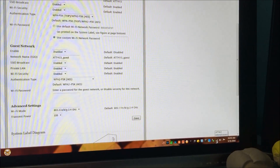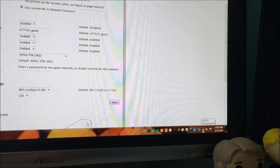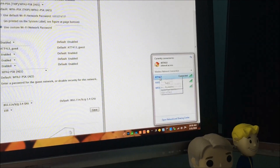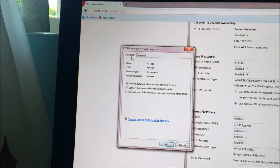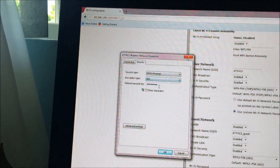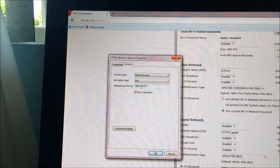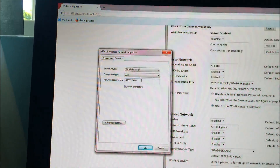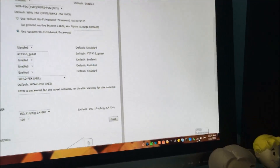Now the best way to get internet access after you reset your router: down at the bottom, you're going to right-click — actually click — find the one that's the AT&T internet, right-click, click Properties, and this is the screen that should pop up. Under Security, if you click Show Characters, it's going to show the password that you set yourself. So what you're going to want to do is change it back to the default password, press OK, connect again, and it should connect fine.